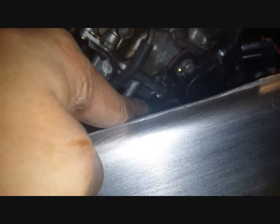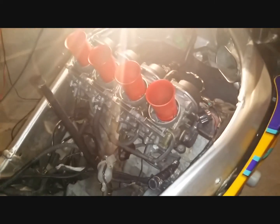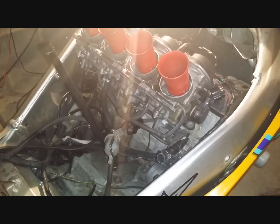That's your rubber boot, and there is a screw in there, just like we had on top. Between the airbox and the carburetor, there's a screw for each of the four intake boots. I need to undo that. So let me just get all the equipment in. You will need the long screwdriver in this case, and reach in for the boots. So there's your screwdriver, and you will see that's your screw there.